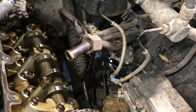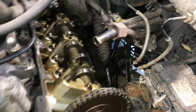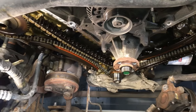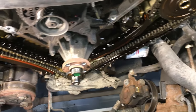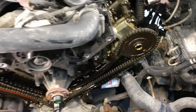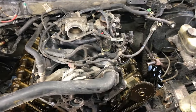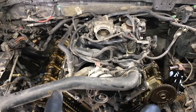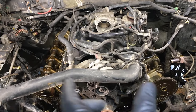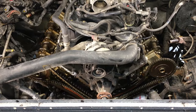Note that the nuts on the EGR on this particular year are an inch and a quarter, so make sure you have a big wrench on hand — some are inch-and-sixteenths, some are inch-and-a-quarter like the big boys. For the front cover area: pull the fan, the shroud, all the front-end accessory drive components. The AC compressor stays in place; pull the power steering pump and lay it to the side. That gives access to the front cover bolts and the valve covers. At this point everything's free and clear to start the timing procedure.